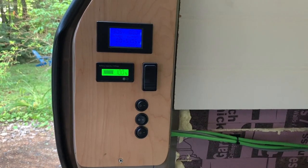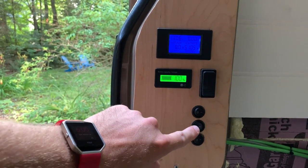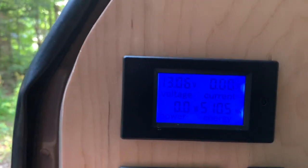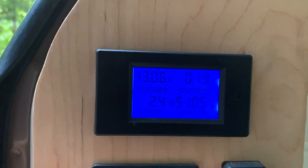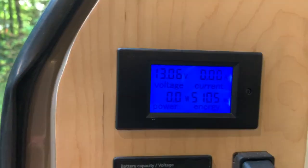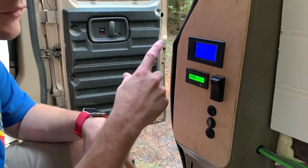This is our main electrical panel for the van. We have an ammeter, voltmeter, battery percentage gauge, and a couple of switches that turn on the panel lights, the back lights, and the ceiling lights. The big rocker switch allows me to read current going into the battery — right now it's just over 0.2 amps from the solar, which isn't making much since it's pretty late — or if I flip it the other direction, it tells me current going out of the battery. For example, clicking on a light shows it's pulling about half an amp out. This is a cheap gauge that doesn't have internal circuitry to measure current in both directions.